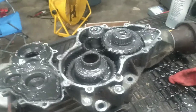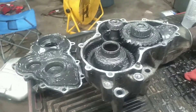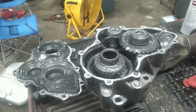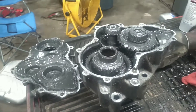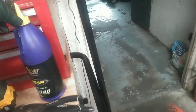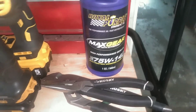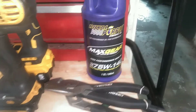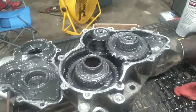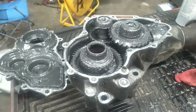As long as you get the old one back to them within a month — so when this video is over I'm going to put the cover back on it, toss it in a contractor bag, put it in the box it came in, and on Monday I'll bring it to the UPS store and ship it out. For lube in the new remanufactured unit I'm running Royal Purple Max Gear 75W-140, and I'm going to be changing it probably once a year. So this is the inside of a failed PTU on a 2006 Ford Escape Hybrid 2.3 liter. Thanks for watching!